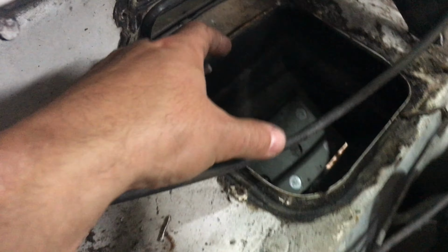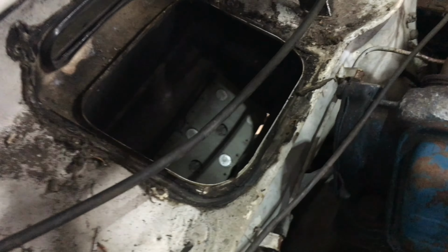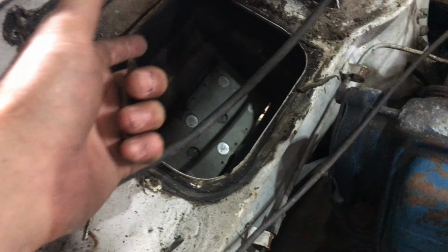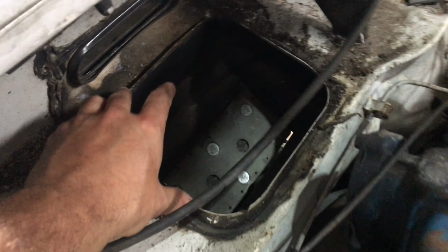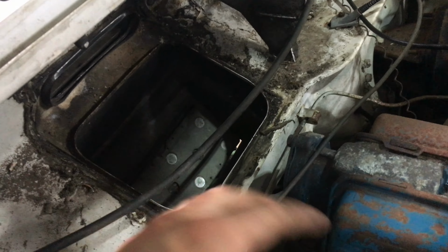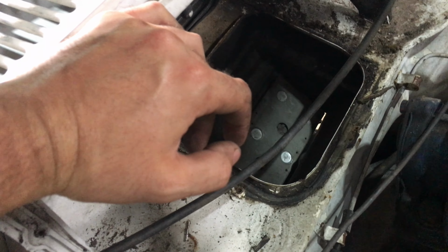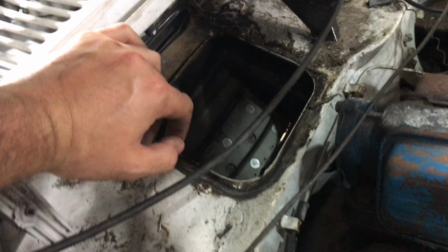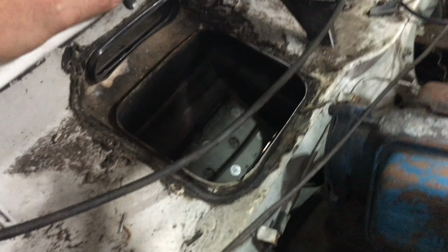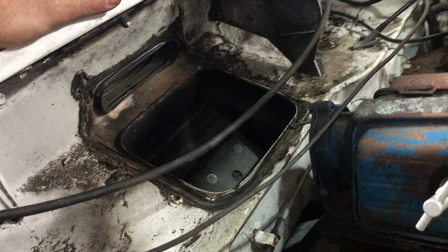If I'm just going to close this off, or maybe convert this to like a cold country system or an American system, let's say Canadian system, where we have an actual little radiator or heater core, if you want to call it that, right? The heater core with a blower motor here that blows actual hot air that's created from the passage of coolant through the little radiator. Although we are in Brazil right now, in the south of Brazil, and winters are actually quite cold, going down to 0 degrees or -1, -2, sometimes -5. So it would be a nice conversion.